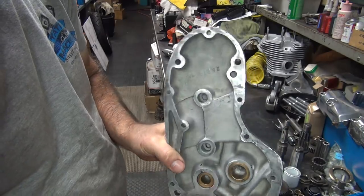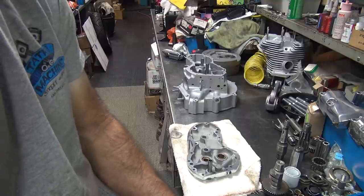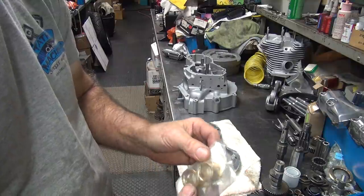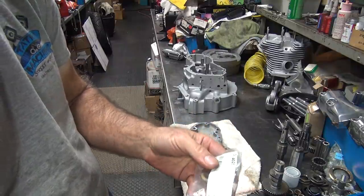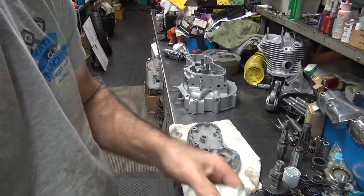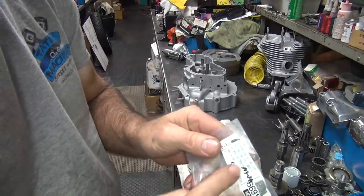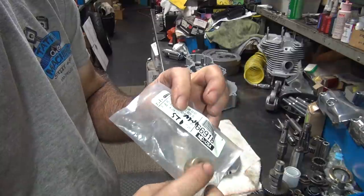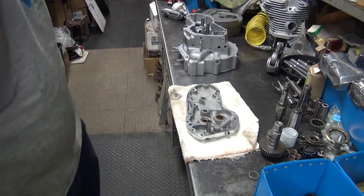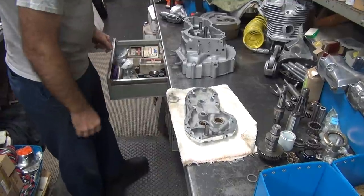So I'm going to go ahead and put new bushings in here because that's what the customer wants. The cam definitely wouldn't hurt to be replaced. The other one, eh, it's 50-50. So we've got some new bushings here — these are S&S bushings. Looks like they're using the same bushing inside and outside. And this is our pinion bushing, which is a Jim's bushing. Hopefully there's some material to ream to. I can't hone these because these are bottomed blind holes — otherwise I'd hone them.